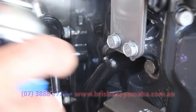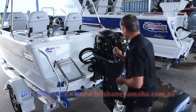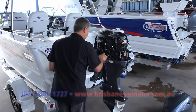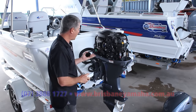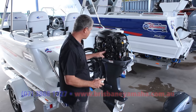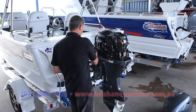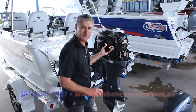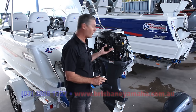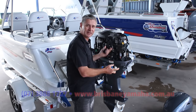The idea is you want to put that protective coating over everything. It's a little bit windy today, that's why we're not out on the water. You should do this every couple of months, and you'll find that a year or two later you can take the cowl off and find that the lubricant has done its job and you have no rust in there. The other benefit is that when you take it to your mechanic, they'll be able to get all the nuts and bolts on and off with no rusted nuts that can snap because they've been neglected.